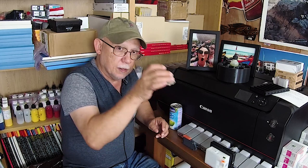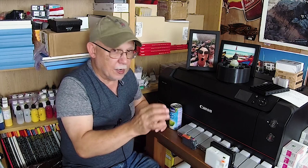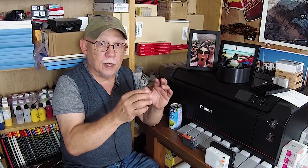This is a Pro 10 cartridge. Internally they have either a prism or a light pipe that can sense the presence of ink, or a very low level of ink, and it will generate that low ink warning. Also, the printer keeps tabs of how many droplets of ink it is generating and ejecting. That information is sent to the chip, and gradually the ink levels are brought down. Eventually you will hit that low warning either physically triggered by one of those internal light pipes or simply by the chip from the information it receives.